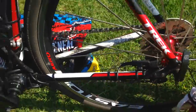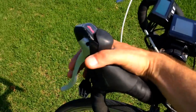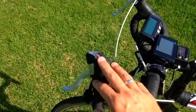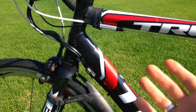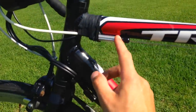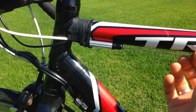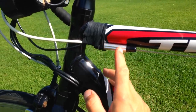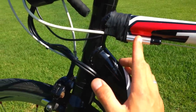What about the e-brake cut-off? You can't do anything the normal way because look at it — it's completely different. You have to set up magnets and it's a dodgy setup. If you've got mechanical disc brakes, which is very likely on a road bike, you just buy this thing — it costs about $10-15, some websites sell it for $9 from China. You just run your cable inside it and there's a little magnet that moves when you press the brakes, which sends the signal to cut the motor.